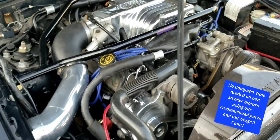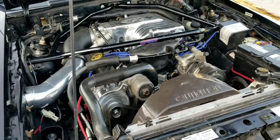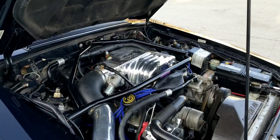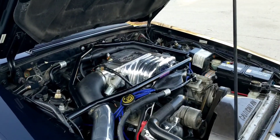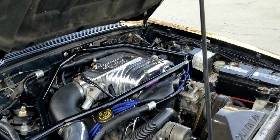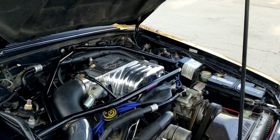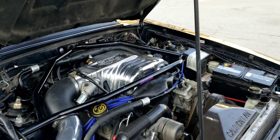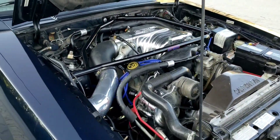As you see, it's no computer tune. Once you've set all the sensors correctly with these parts and the camshaft, you don't need to really have a computer tune. Air-fuel ratio is in the mid to high 12s at wide open throttle. We have the total timing set at 34 degrees, which is 18 degrees initial. Starts up and drives perfectly, sits here and idles all day.